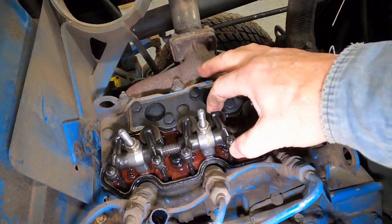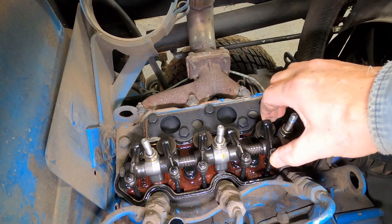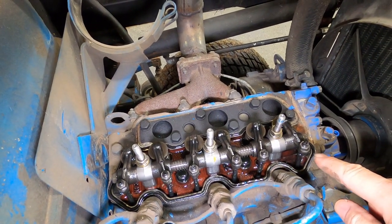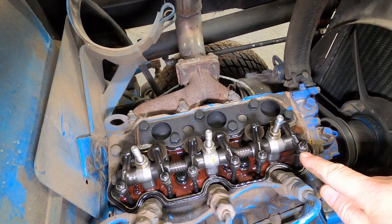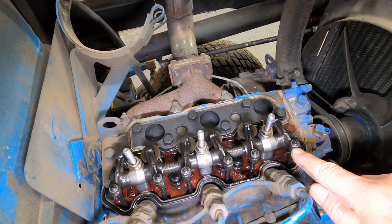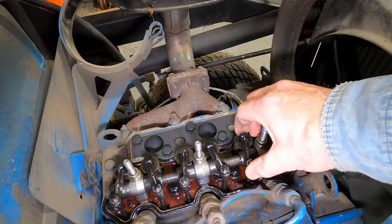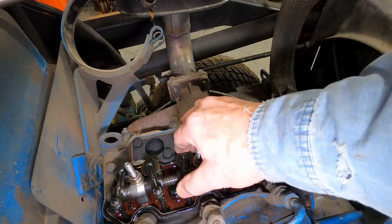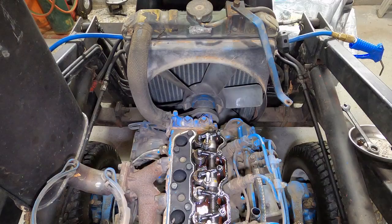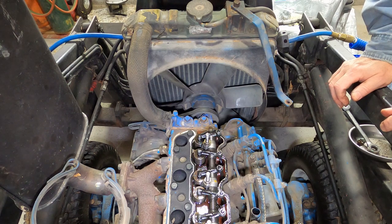I lost recording here, but what I'm doing is checking for any movement in the rocker arms. You'd expect with about 8 thousandths clearance that the rockers would wiggle a little bit back and forth. I was looking at which valve was open and which was closed. The adjustment is easy — I'm pointing here to the nut that locks the set screw adjustment. It's a machine screw with a slotted head that takes up the clearance, and the lock nut below holds it in position. On the valves that are completely closed, there should be some degree of play — and there wasn't.